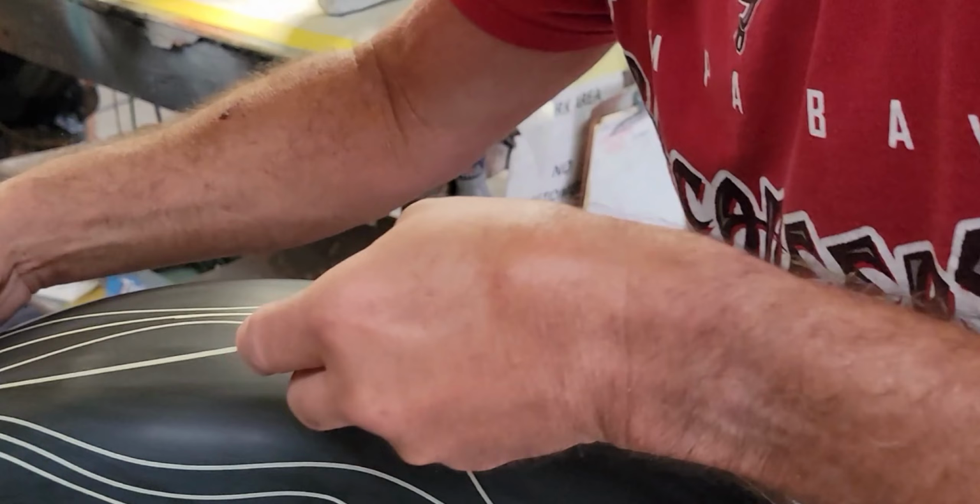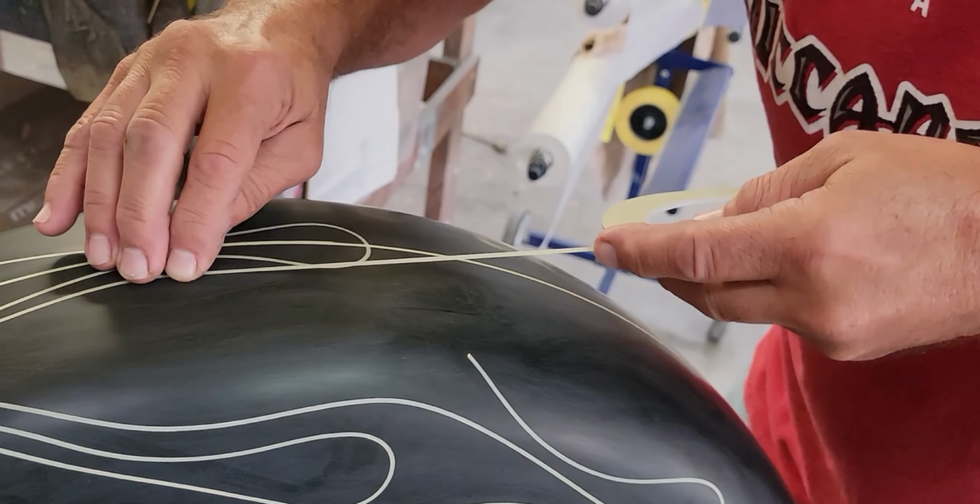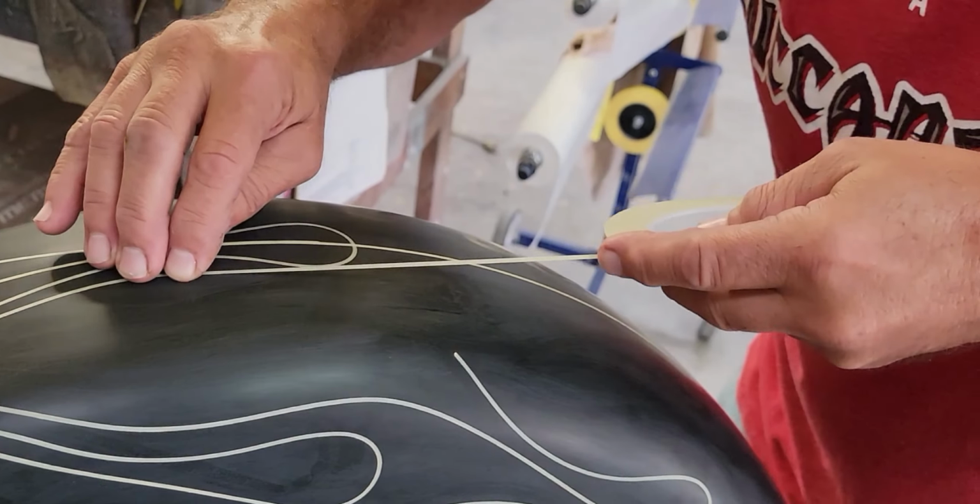Okay. You want a nice taper job. Start at a point. Gradually get bigger and bigger. Swing back. Another thing too, quarter inch gap, quarter inch gap. That makes it easy. You put your 26344, your quarter inch masking tape, in between those. Realistically, you could go 16th, 16th, and an 1/8 inch, because all those combined would be a quarter inch, but that's pushing the envelope. If you leave a quarter inch spacing in between, you're good.